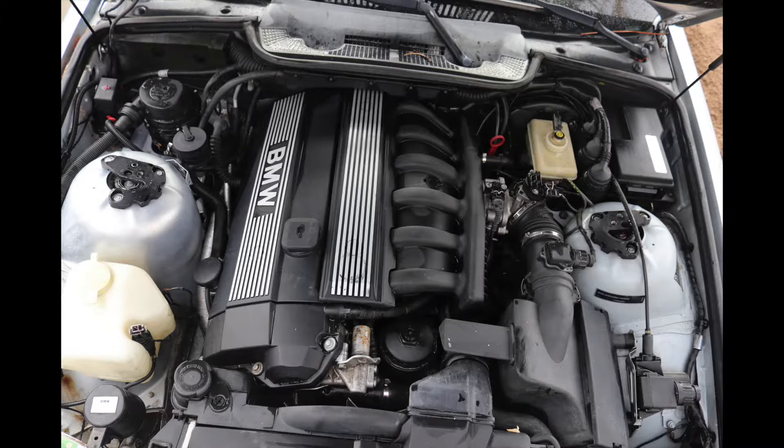Now that we've finished cleaning all the easily accessible surfaces, we've got to clean the areas and components that are hidden and in tight spaces. For example, the power steering reservoir is actually underneath the intake manifold. To properly clean that area, we'll have to take the intake box and the intake manifold out. I already know for sure there are leaks there because I've seen the reservoir — there's oil everywhere. We'll have to do this for all those tough-to-reach areas so we can remove and replace anything that needs to be replaced or fixed.